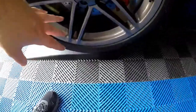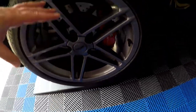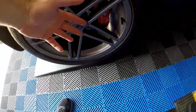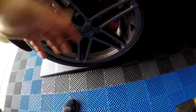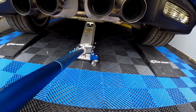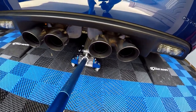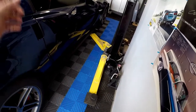Let's put the race ramps in place - here's one on the driver side, passenger side, that's two. The race ramp isn't going to be sitting centered on the tire because this is almost a 14-inch wide rear tire - it's a 345/30/19. The race ramp obviously isn't the width of the tire, but I just need to get it under the tire and get the car in the air. Now I'm just going to loosen the floor jack.